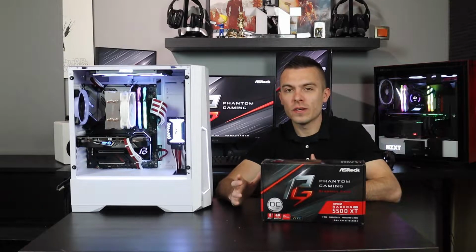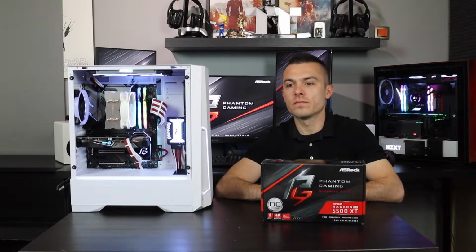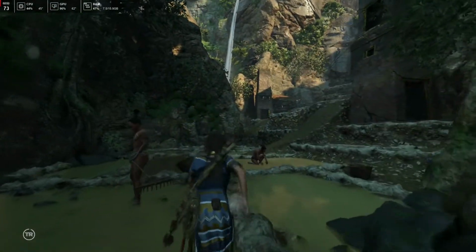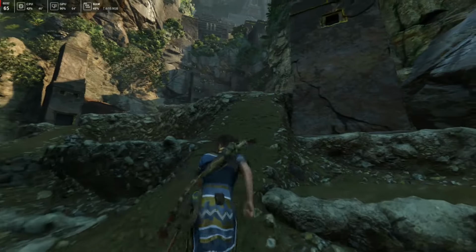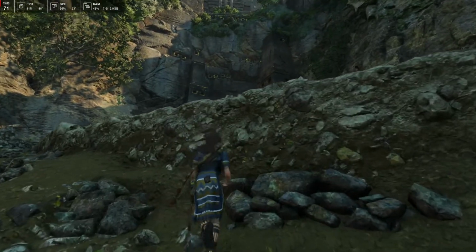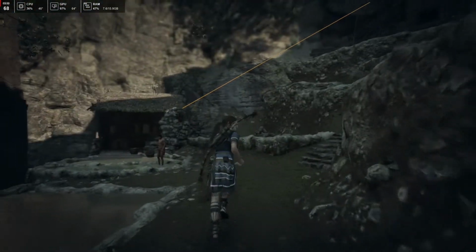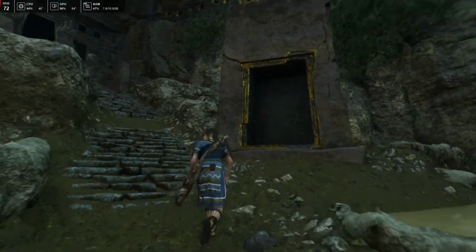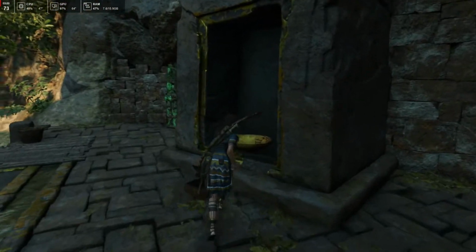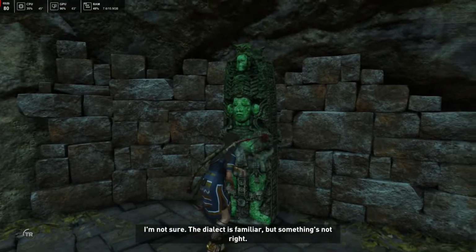Now let's talk about how the RX 5500 XT performed during the same games that I played on the RX 590. That means we're going to talk about Tomb Raider, Witcher 3 and PUBG. Tomb Raider on high details, so basically the details were the same on the RX 590 and RX 5500 XT. The RX 590 had 72 FPS, but the RX 5500 XT had 70 FPS on average, and the temperature was actually higher on the RX 590 by 10 degrees with almost the same load, at 2%, that's nothing. So 10 degrees more on the RX 590, definitely in this one the RX 5500 wins.